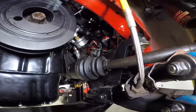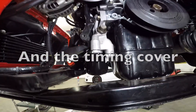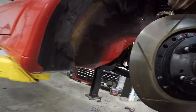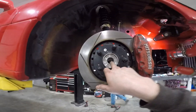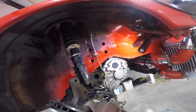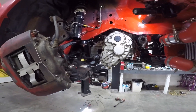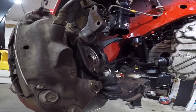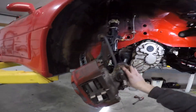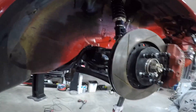Got the oil pressure sensors hooked up, got this axle back in and the half shaft, got it all hooked back up. If for some reason you didn't see how I took these apart, I just take these bolts out and take your tie rod out, then drop this down flat — it just slides in and then you pick it up and put it in there. Put your axle in there, fold it over, then slide your axle into your transmission and into there. Same thing on the other side — you just got that half shaft, which is a lot harder to deal with. It'll pop in; you'll see when it's flush on the transmission. Then just put it all back together.